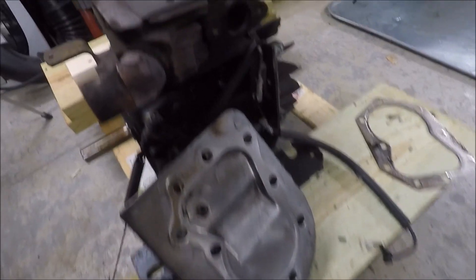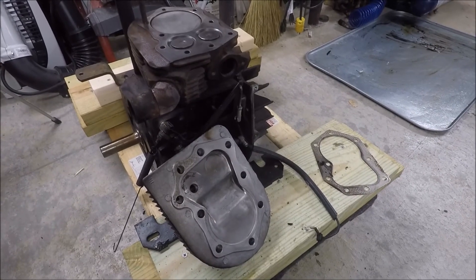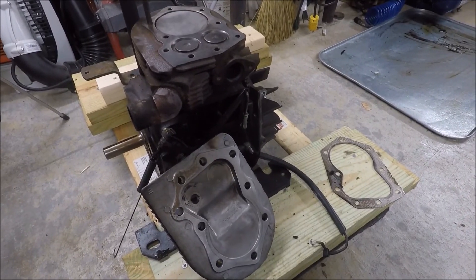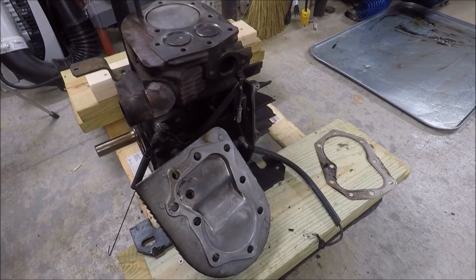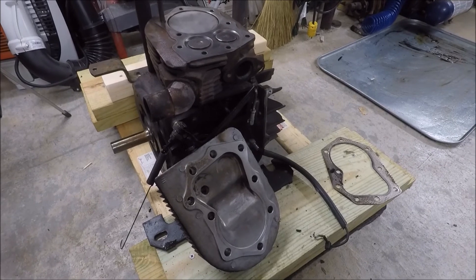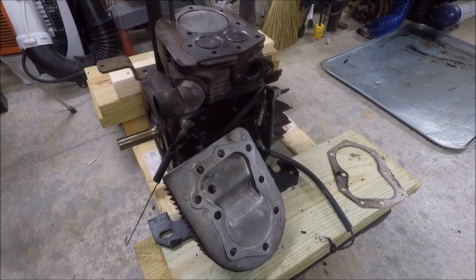I got most of the carbon off of both areas of the engine. I think the thing to do now is to go ahead and pull the piston out, get a micrometer on the piston and the bore, and just see where this engine stands. Depending on what I find there, that will determine whether or not I go any further with rebuilding — or if I just go ahead and put it back together and run it. I might even have to end up sending this block out to a machine shop to have it bored over. We'll probably cover that in one of the next videos.